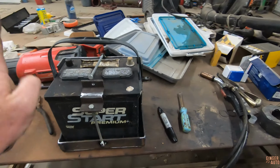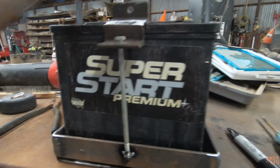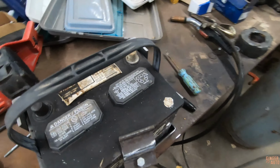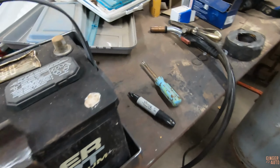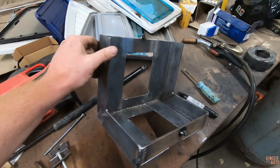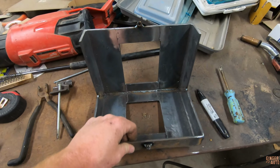All right, I think I have the box done for the most part. Unfortunately, we only have six inch bolts here for a quarter inch, and I need like 6.5. So I'm going to have to still go to the store, get some new, longer ones, but pretty happy with how this came out. Pretty simple. We just have these long bolts that go to the top and bottom with this piece here. And then screw this. The rest of the box is just a pretty straightforward box. So nothing too crazy. But I think we are ready to go mount this on the cab, so that we can actually make some progress on the wiring.